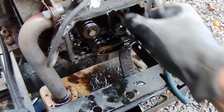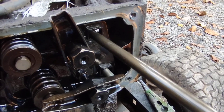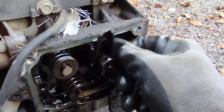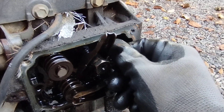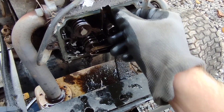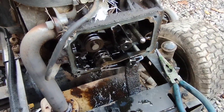Also keep in mind: these push rod guides that go in there are plastic, they do wear out, and they come out and get lodged in there, allowing the push rod to rub on the side of the actual head itself. So check those while you're in there — pretty easy fix as well. Hope this helps you.